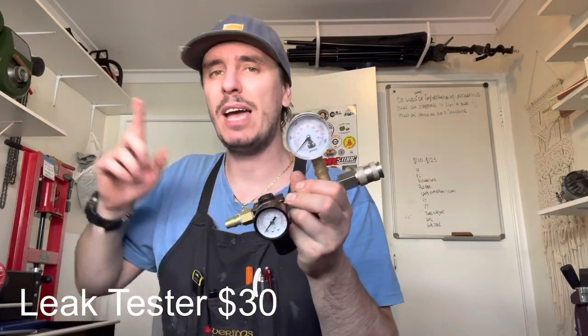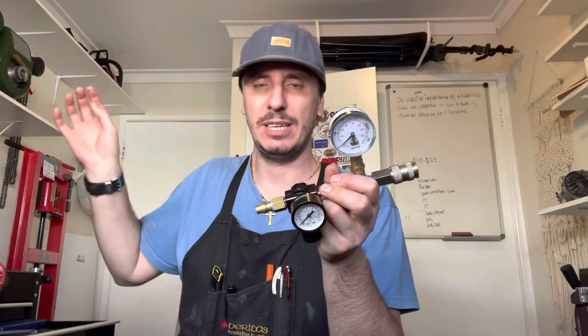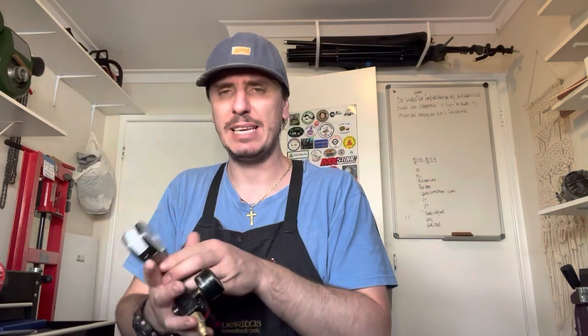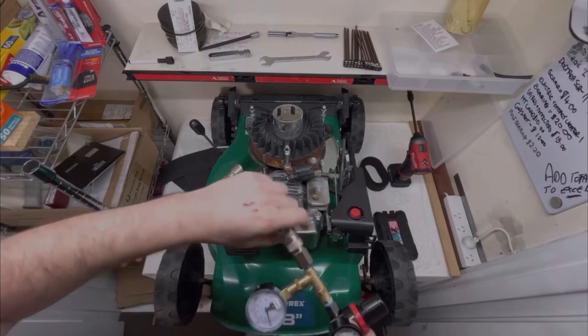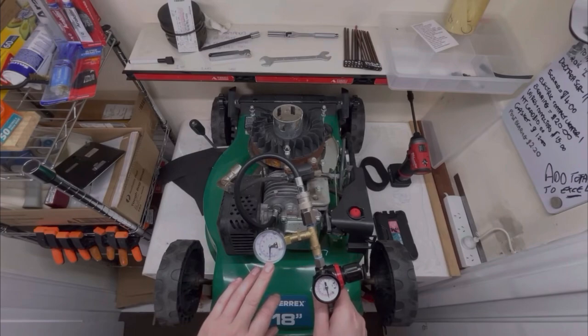A leak down tester. You can just pump air into a four-stroke engine and see where it's coming out — whether it's past the valves, past the rings and out of the crankcase ventilation system. But having one that can tell you how much it's leaking is so useful, because all engines leak. Having that quantifiable number to say it's leaking but still within an acceptable tolerance is incredibly important. And from there you can tell: is it leaking out the intake, the exhaust valve, or the PCV valve? Having both tools gives you a little bit more information as to the health and condition of your engine.